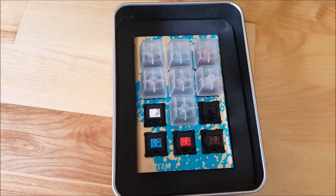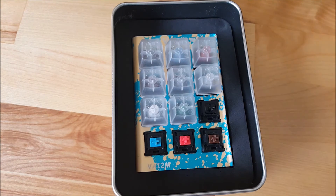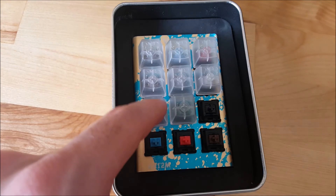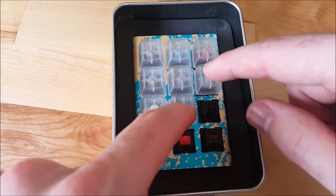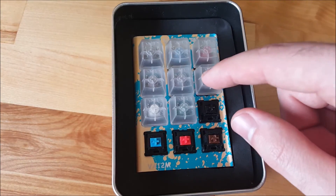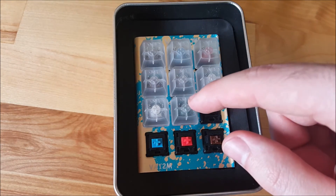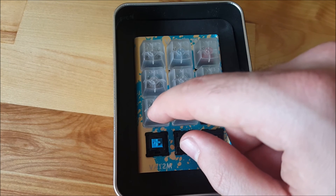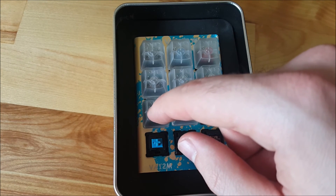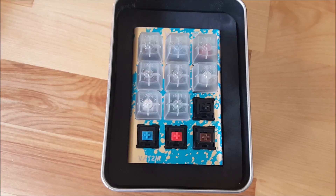Hopping over to the last Cherry switch, we have Cherry MX White. Cherry MX Whites are a stiffer switch — they also require 80 centinewtons of force. This has changed over the years, so if you're looking at an older keyboard that has Cherry MX Whites, it might require less force. Cherry MX Whites are kind of a cross between the Greens and the Clears — that's what they kind of feel like. You can hear they have some sort of click to them, whereas the Clears don't. But it's a lot softer than the Greens, and also less tactile.